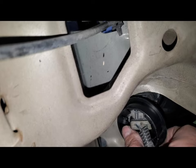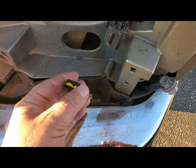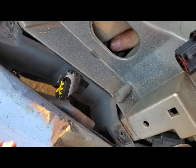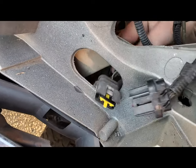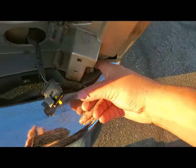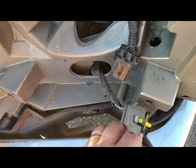Now we need to install the light assembly in the truck. To make things easier, take the parking light and turn signal light and push it through this bottom hole and pull it out through here. Easiest way is to reach inside and grab the cable, push it through, and run it back up through the hole. That way if you have to change those bulbs later it's easier. Do the same for the other one — reach through the fender well and push it up through this section.